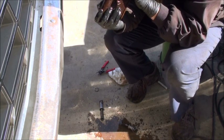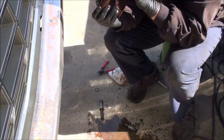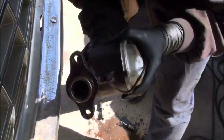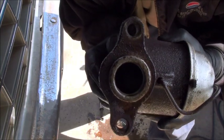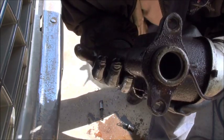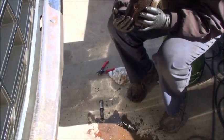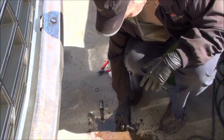I can tell you right now, by looking down in this bore, this one is extremely worn — it is not true. They've honed the far back of this, which there's no way you can see. They have honed the snot out of it. It's actually stamped and rippled — it looks like a bad paint job down in there.